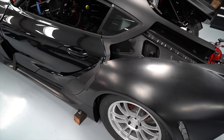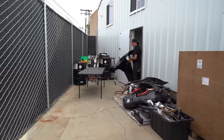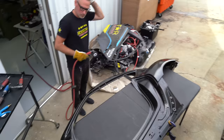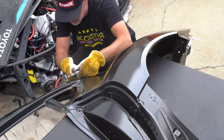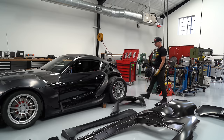We take another quarter panel from a part we get from the Toyota dealer. When your car gets hit from the side and they need to repair it, body shops can order these whole quarter panel rocker A-pillar kits. That's what we ordered — this whole side of a car essentially, but just the sheet metal. After deciding how much of it we needed, Sean went in back and cut off just the part we were going to use, and we started installing that on the car. The cool thing is these parts can be replaced relatively easily at our shop — we don't have to un-weld things and take them to a body shop. We can just drill out the rivets and replace that quarter panel relatively easily. We've built the last couple cars this way and it's worked out really well for us.